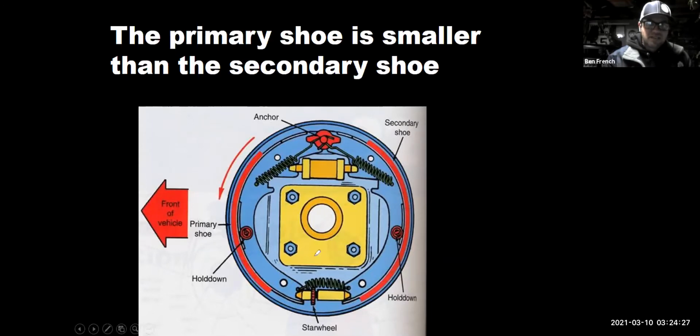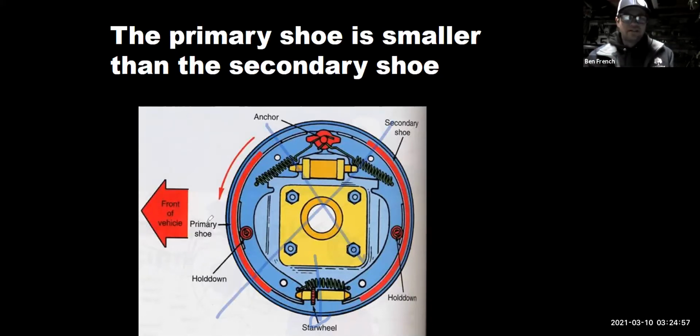My tip for you guys, this would be tech tip number 8: don't work on drum brakes until you're ready. I wouldn't recommend messing with them until you're actually in brakes class. And to follow that, if you're going to do drum brakes, you only do one side at a time, so you can use the other side as an example to look at, because I guarantee you're going to take all this stuff off of there and then you're going to be like, oh, I forget how it goes, right? Now, these days we have cell phones. We could take a picture of this with our phone and that would be a great idea. But sometimes the picture just doesn't tell the whole story. So by doing one side at a time, you can look at the brake on the other side of the vehicle and use that as an example to figure out how to reassemble the brake that you just took apart, okay? Again, get those special tools if you're going to service these things.